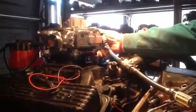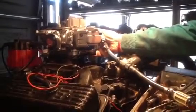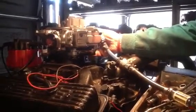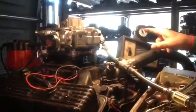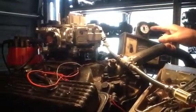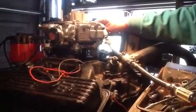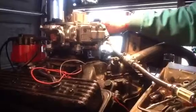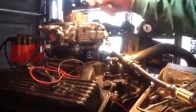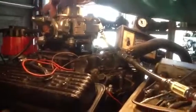As you can see, it's going to stop right here at about 12. When we accelerate it's going to thin out — the faster I wrap it up, the more it thins out. I'm going to wrap it up more to get the back barrel to kick in. There's the back barrel opening — there's a hole here that sucks air, and there's a certain suction that opens the back barrel via that lever back there.